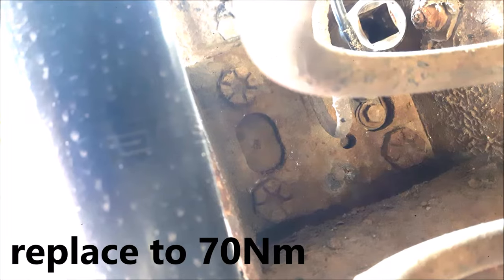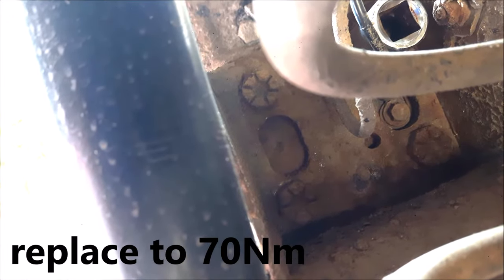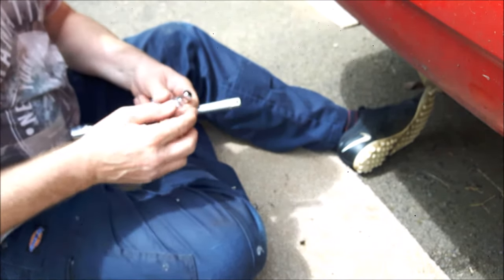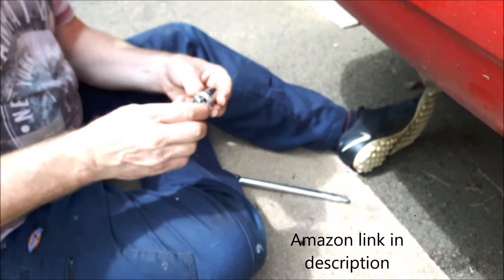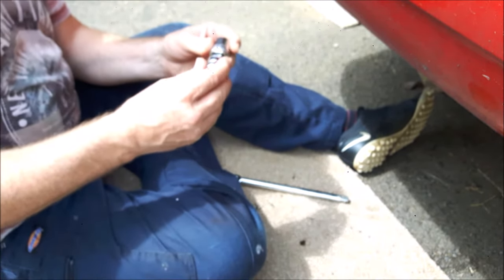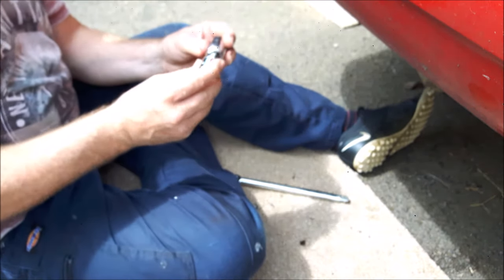If you look through the coils of the spring, those bolts hold the hub to the back plate in the axle. You will need an extension bar to get through the coils of the spring, but also use an extension bar or adapter that allows you to wobble your socket, because that top right-hand one — the one you just saw with a socket already on it — because of the position of the brake pipe union, you cannot get straight on to it.